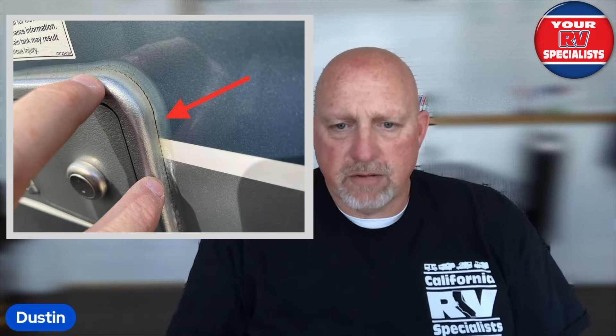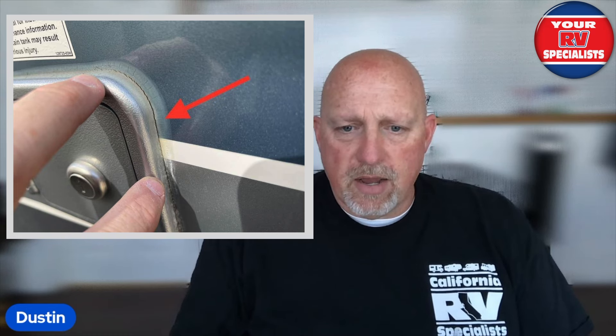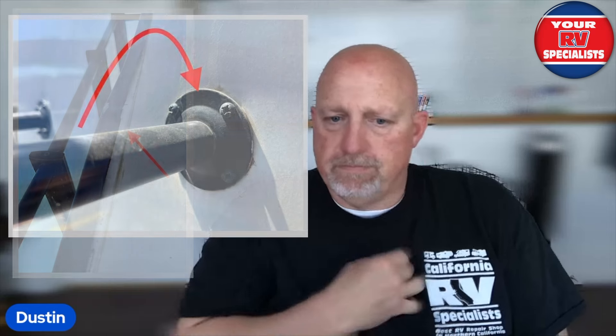Again, this is a topical — it's designed to deflect the water and help shield it and keep it from getting in. If you're a police officer and I tell you that you don't have to wear a bulletproof vest — you get shot, you get shot. And basically that's where you're at if your coach doesn't have sealant on it. By putting on that bulletproof vest, if you get shot, it's going to bing and deflect off of you. Some moldings behind them — there's nothing at all behind them. So if that topical silicone is dried out, shrunk, cracked, separated, or coming loose — guess what? Water's getting into your coach and it's damaging it. You're not seeing it at that time, but sooner or later you will.